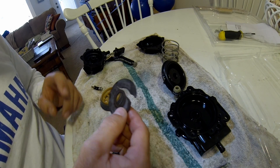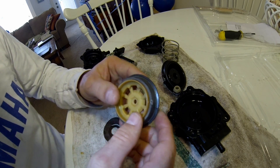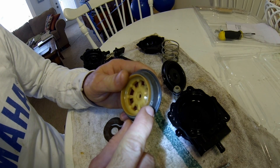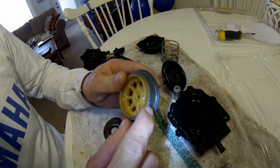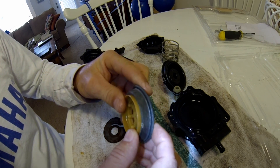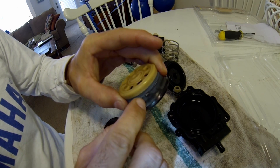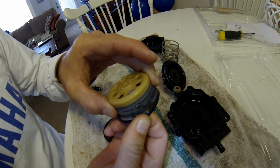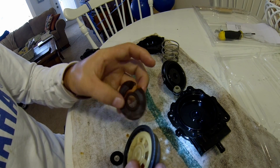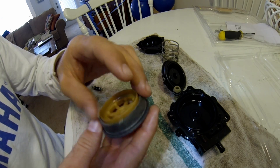However, obviously that's going to get replaced when I get my kit. And this — hopefully you can see it — this was my issue. Right here, this diaphragm cracked. I'm going to flip it inside out and show you the hole. You see the hole goes through to the inside. That, along with this broken disc, is the reason my fuel pump wasn't pumping properly.